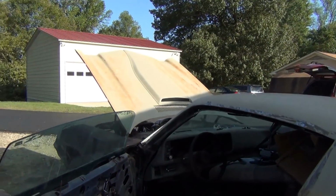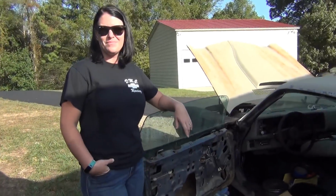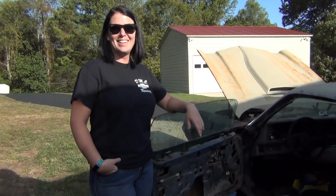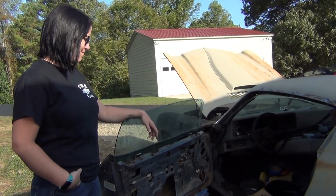Even the vacuum secondary 750 was too little, which I know everybody likes vacuum secondary carburetors. They work. You can tune them to work. I have a double pump on everything. You got to, because you rely on that secondary to come in. And they're good for mileage, but nobody gives a crap about mileage. Yeah, we're not building this car for gas mileage. No, it's the amount of miles and the fun you have and the amount of miles you go before you got to fill it back up. But it will be good.